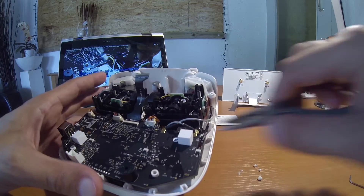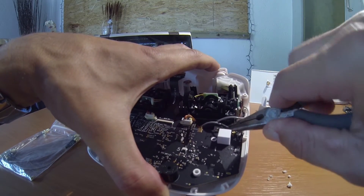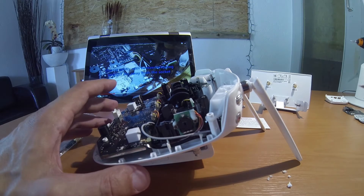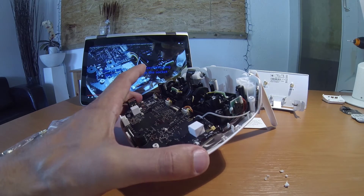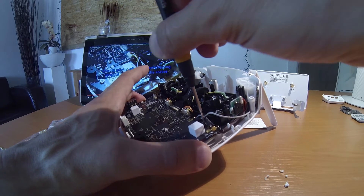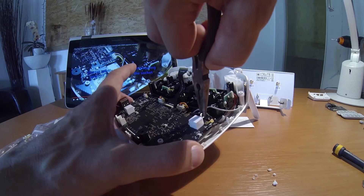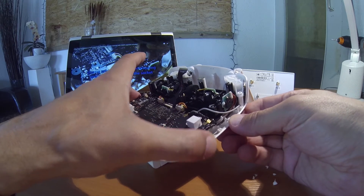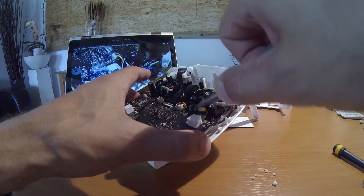I'd better do this one first. It's coming, but there's a screw over here and that's blocking the way. This screw — I cannot pull it out further than this. I think I'm going to loosen up the board because there's only a screw over here. I'm going to kind of grab this and lift the board. I can, but I have to be careful not to damage anything else. And now it easily comes off.